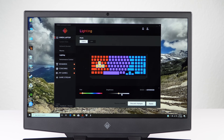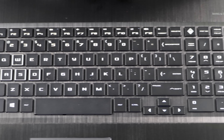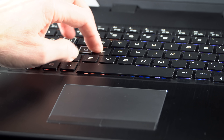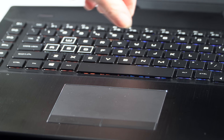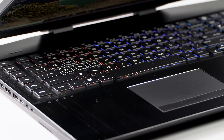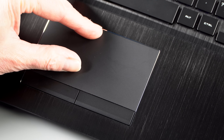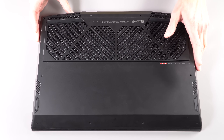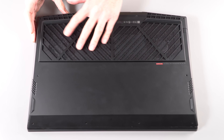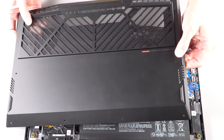You can also control the keyboard backlighting. The keyboard is pleasant — nice tactile feel, plenty of travel, 26-key rollover. It might not quite match the SteelSeries keyboard on MSI for typing but it's still pretty good. There are four backlighting zones: the WASD keys and then left, middle, and right — on or off basically, with no star or wave patterns. It's a Microsoft Precision trackpad with two clicker buttons and it works very well. Opening it up is easy: 10 Phillips head screws, with shorter ones toward the front edge — remember that when putting it back together. You can see there's lots of ventilation; use a guitar pick to work around the edges and the bottom lifts off.